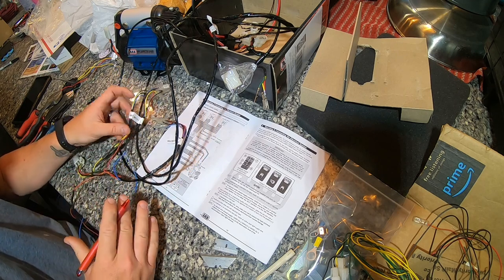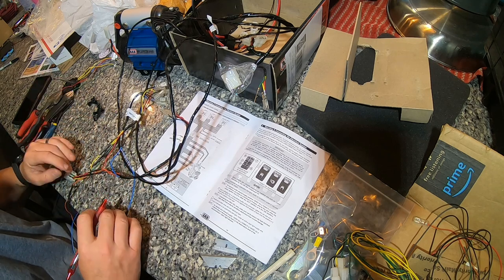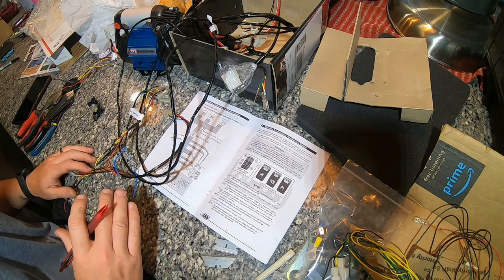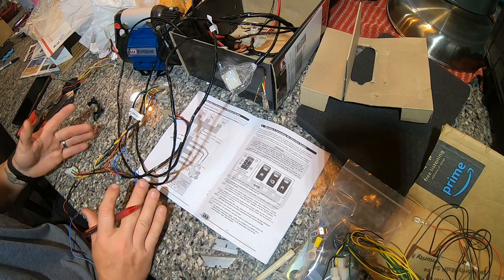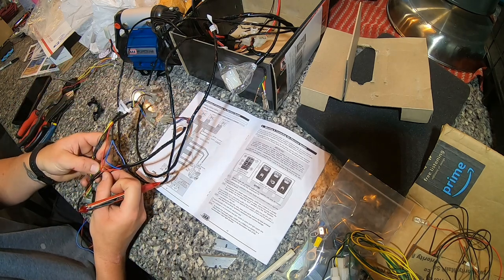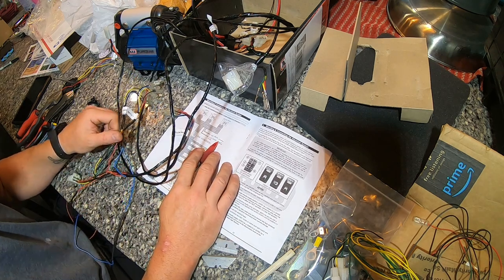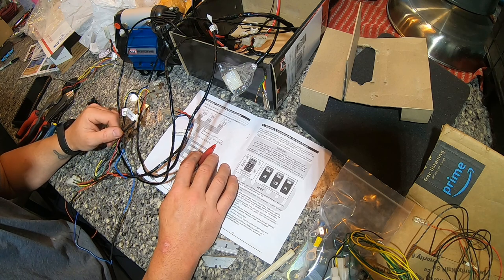As you can tell, what we're taking out here is just switch one and two. I'm doing this where I'm mounting all my switches — I don't need all this extra wire. There's a lot of extra wire if you're mounting this in your actual engine bay. Now if you are running this all the way back into your vehicle interior to have switches separately, you probably would not want to be doing this. These are your red-yellow and your blue-white wires, so you see your red-yellow coming in and your blue-white — these are running so that when you turn your ignition on, the light on the switch actually comes on.